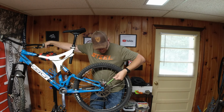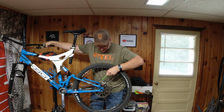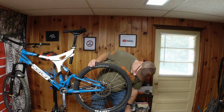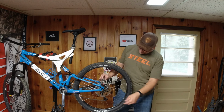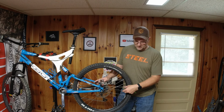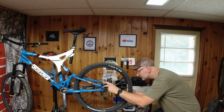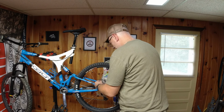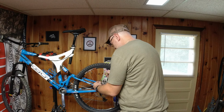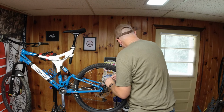Because it doesn't really do me any good to bring this all the way in and have it snug against the inner pad if I can't back the inner pad off a click and get my clearance that I need. Because that dragging right there, that's going to be the inner pad. So now I can back it off a click or 2, or 3, or 4. And sometimes you just gotta play with it. Do your old manual eyeballs. Sometimes that works out better than anything. Just give it a smidge, not a smudge. He's mean. There we go.